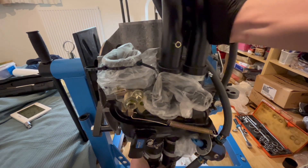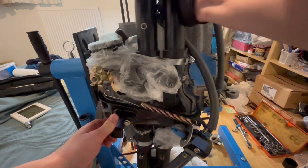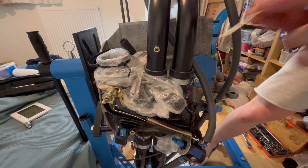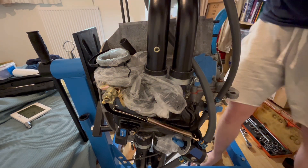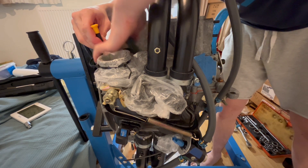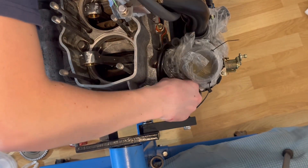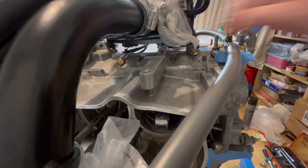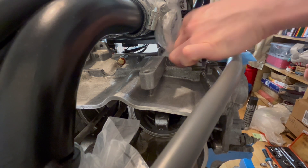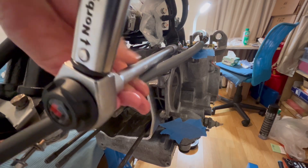Afterwards you will need to remove your intake manifold in order to replace the throttle body and the intake plenum, depending on which version of the MansiSpeed EFI you got, and then you need to re-torque of course. The intake manifold is held on by two nuts and they need to be tightened to spec, and you also need to add sealant to all contacting surfaces of the nuts. This has to be done to assure that there won't be any oil leaks.